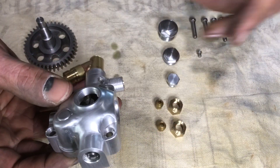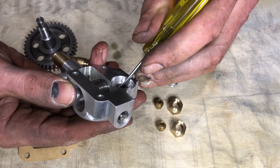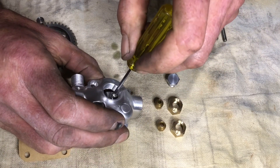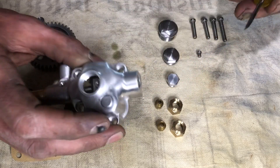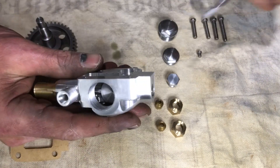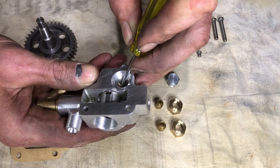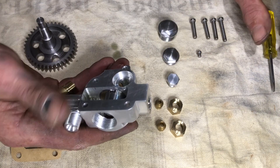Now for an adjustment — we put the worm gear all the way up to the top, screw that in, tightens down on there. So as the shaft rotates, it goes up and down. Every 82 crankshaft revolutions of the engine, this goes up and down once and delivers a very small amount of oil each time to the crankcase.